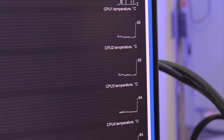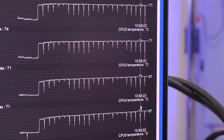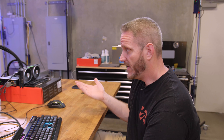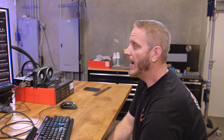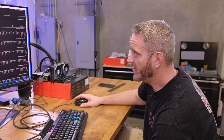That's already 5°C lower because it spiked last time to 70. I hate when smart people are right. Our temps, as you can see, are just not climbing anymore — 72, 72, 70, 69. It's about the same, honestly. If we look at cores 11 and 12 again, the two hottest: 78, 78, they max out at 79. We can't call that one degree anything other than potential margin of error. It's almost like this CPU doesn't have whatever issue other CPUs are potentially having. Maybe this one's a little less concave than others, or maybe the TIM inside is better applied. I just did the spacer mod and nothing really seemed to change.